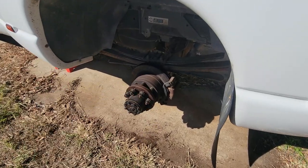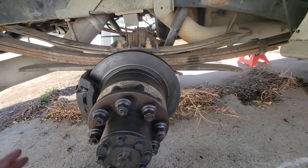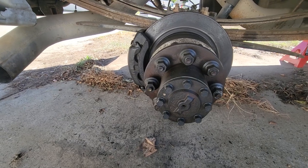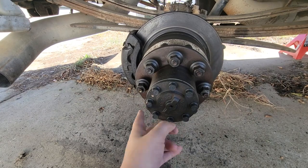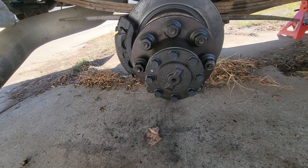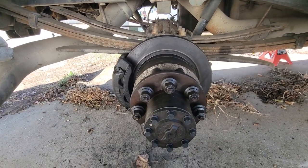It's the next day — it's all bolted up. On this side, same deal. I replaced all the bolts from the old ones to the new ones, got the brake caliper on, got everything clean, got all the oil off. I didn't show the torquing process through this — it's really pretty simple. You torque these down to 95 foot-pounds. What I ended up doing was taking them all to 25 in a star shape first, then went to 95 crisscrossing in a star shape, and then went all the way around just to make sure every single bolt was tight.